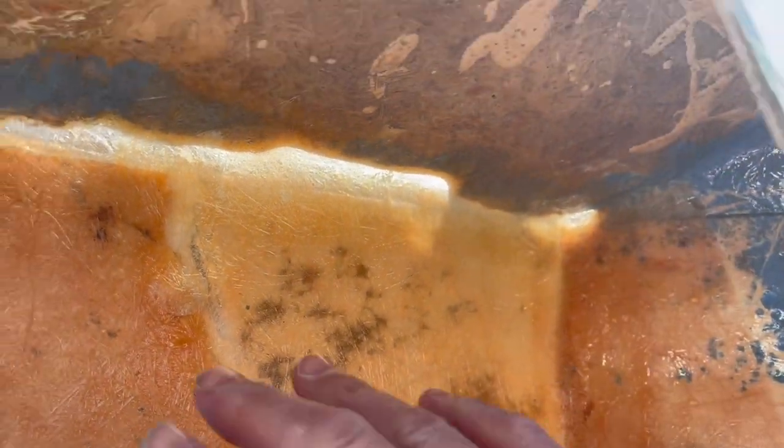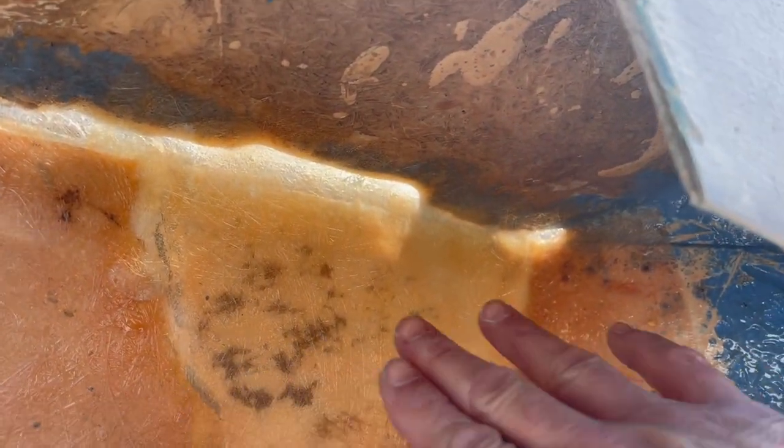Right, that's about the third layer, just on the back, just to get the basic shape. So now I've got to cut a bit the same size as that, so I can pack it out and build it out, and then I can put a couple of skins on the back, and then I can do the front. I just sort of thought, I'll try and make a bridge there, so I've got something to bond to, something to fiberglass to,